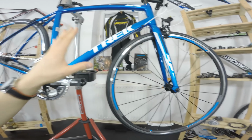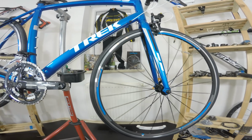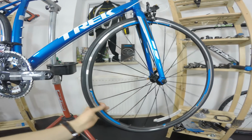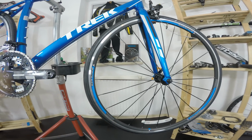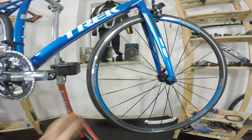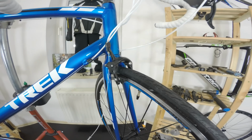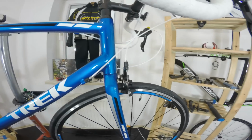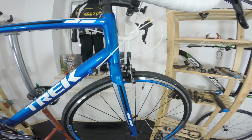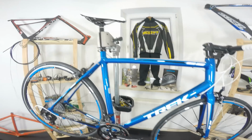The budget bikes are also quite often a choice for heavy riders who want to be more fit or lose some weight. 24 spokes is just fine. The wheel will be stiffer, stronger, and easier to true as well. As I said, calipers are no name. Those will just do the job, something just enough for us to start out. Of course, nothing super for really crazy descents, but it's just okay for an entry-level bike.